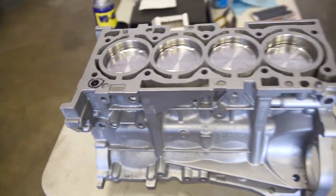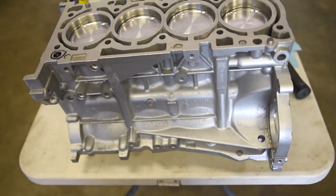I'm going to flip this motor over to get the rod caps on and torqued. Now that we've got the pistons down into the cylinder walls and flipped the motor over, it's time to get the rod caps on. We need to have the bearings installed — as they already should be since we checked all the bearing clearances with the Plastigage in episode one. It is very crucial to have the rod caps go back on the same rods they came off. The bearing tang, the little slot that holds the bearing in, goes to the bearing tang on the rod.